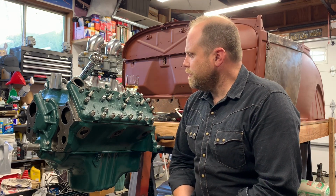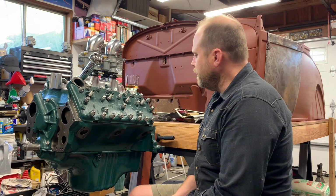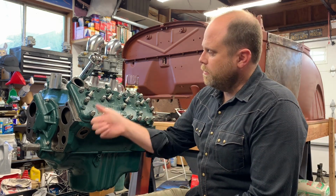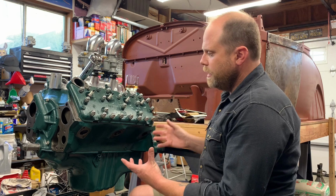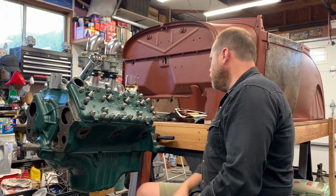It should scoot. You know, I mean, what is it going to make? Maybe 150 horsepower. You know, it's not going to light the world on fire, but it's a decent little mill. And I'm really excited to fire it up for the first time. And I'm close. Basically, I have to rebuild the oil pump, and I have to put the water pumps on it, and I have to basically put all the ancillaries on to seal everything up. And I got to recheck the timing gear in the back too, because I don't remember what I did with that. This is such a long, drawn out build.